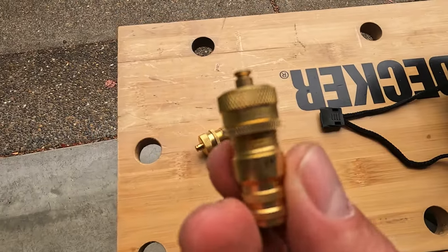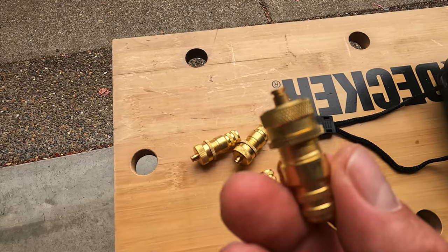Basically what it comes down to is you're paying for quality and for time. I also want to test the accuracy of the auto-shutoff setting. From experience with the Milwaukee, setting it to a certain PSI and then checking it on the dash shows it's not quite there — I actually have to set it a couple PSI higher to get where I want to be. I've made my own four-tire hose kit, and this will be a good test just by changing the compressor. I'm going to air my tires down to 18 PSI using my auto deflators, then double-check on the dash.